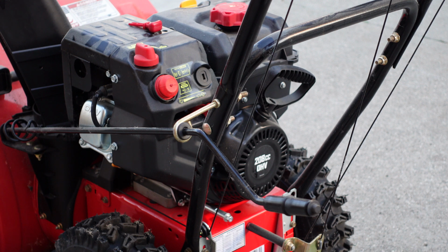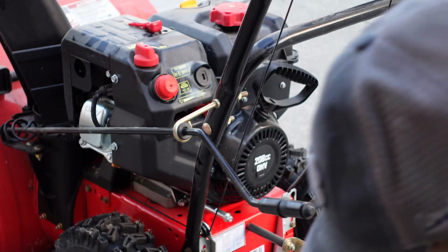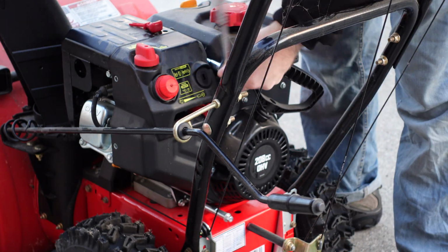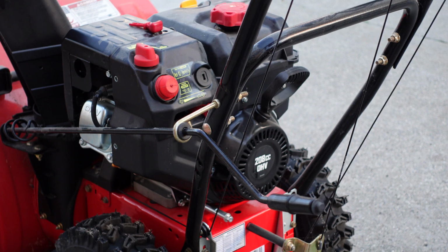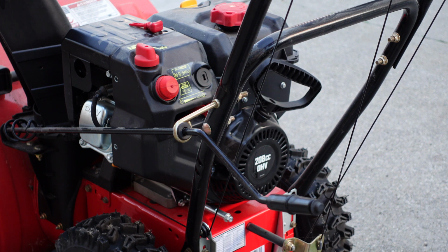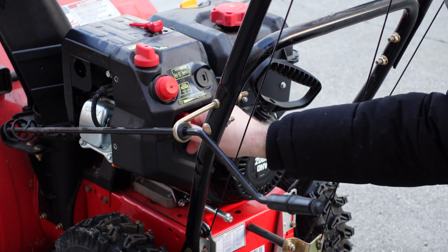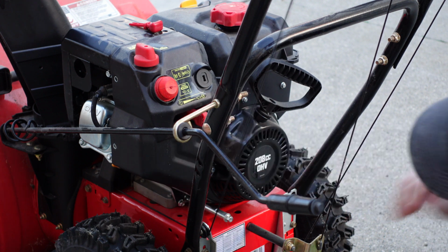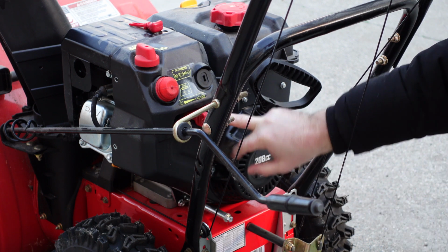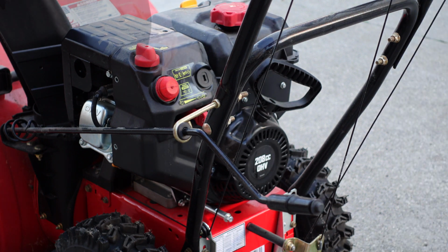So here we go. I'm going to take off the front. There's two bolts there, one there, all 10 millimeter. Now on the primer here, there's a slot right in here that this has to be lined up with. You won't be able to see it from the camera without me moving the camera, but let's get this right there. You can feel a little groove inside there. I've already taken the key out. I'll put this with this.